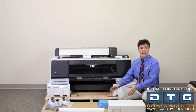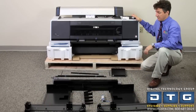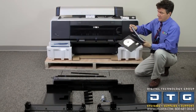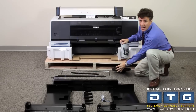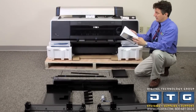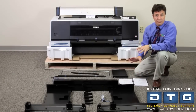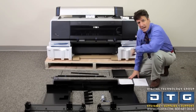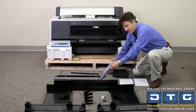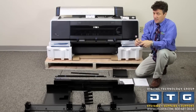We've basically unpacked the stand from the box that sits on top of the printer. Important note: at this time you can take out the black leather-bound Epson case with the 7900/9900 printer guide. In the very front of the guide you'll see how to assemble the stand — it'll go through unpacking and assembly steps. The stand package includes two legs, a manual holder, a stabilizer support cross beam, and a paper tray catcher. There's a small bag in the box holding all the nuts and bolts as well as the Allen wrench you'll need.